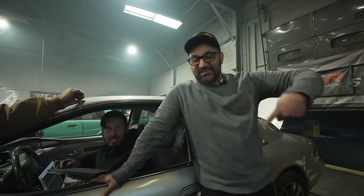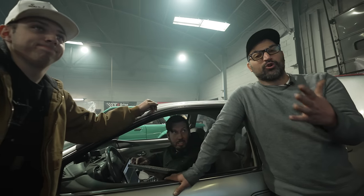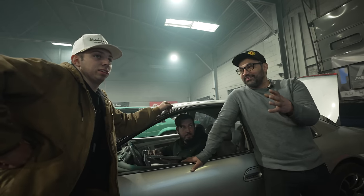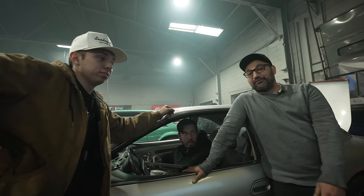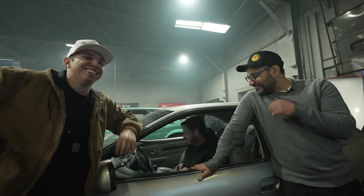Yeah, so we are running into an issue. If you recall, we are running our tiny restrictive stock exhaust manifolds into that pretty ridiculous U-pipe, and it's getting fed up. We knew it'd be restrictive, and I think we're finally getting close to finding the limits of this thing. It's making 475 horsepower at the tires and 510 pound-feet of torque. 50 horsepower, yeah, it drops. You can watch it drop off.